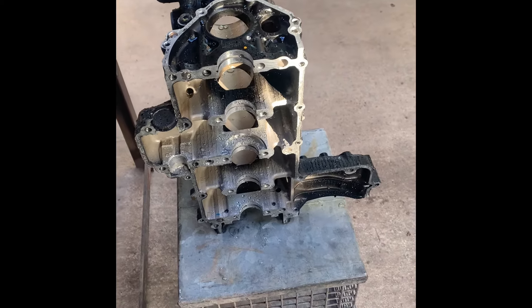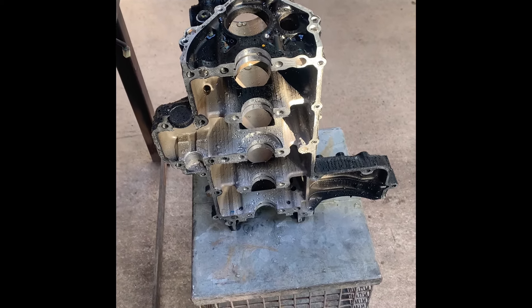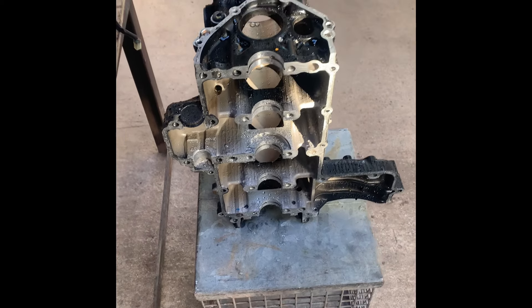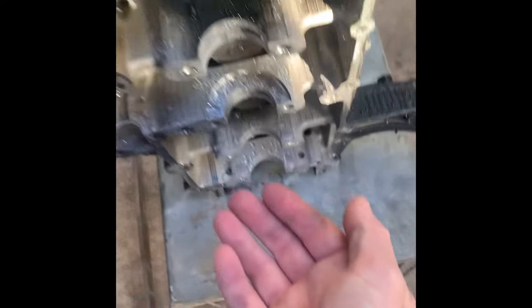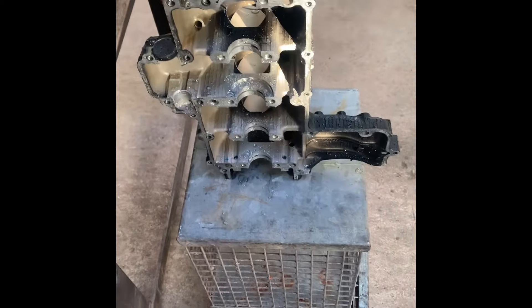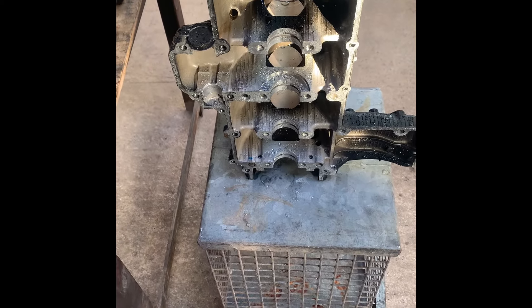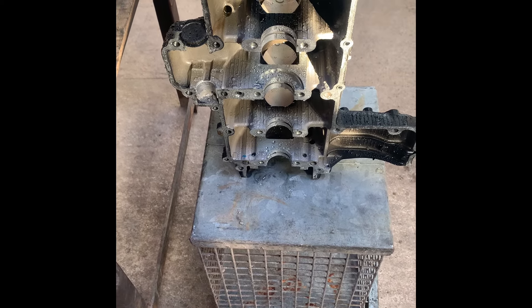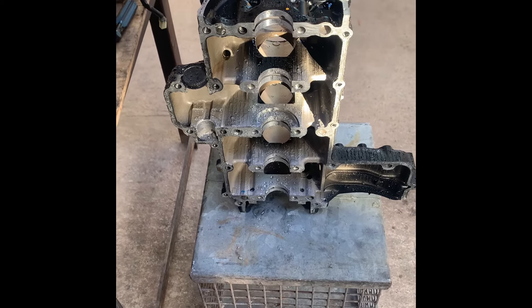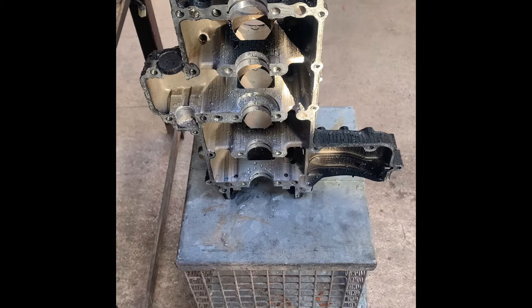This engine, unfortunately unusable, I pulled from the scrap bin just to demonstrate. The 2015-2016 version did not have these holes bored in the block. What they found was once they bored the extra holes through it - like they did with the K3 and K4 - it balanced everything up better. It worked out at closer to about 10 horsepower with all the additional mods. The S blocks are pretty much identical from 2017 up to what appears to be 2021.